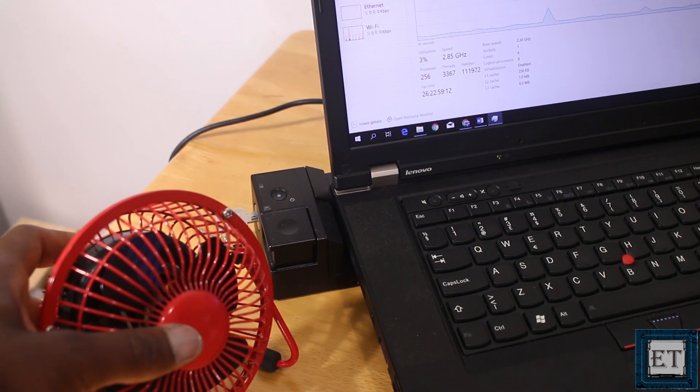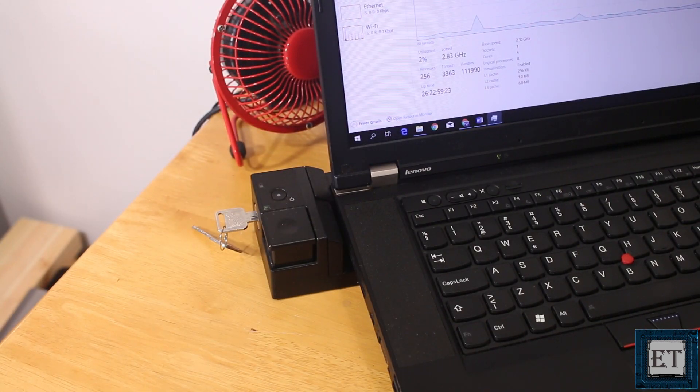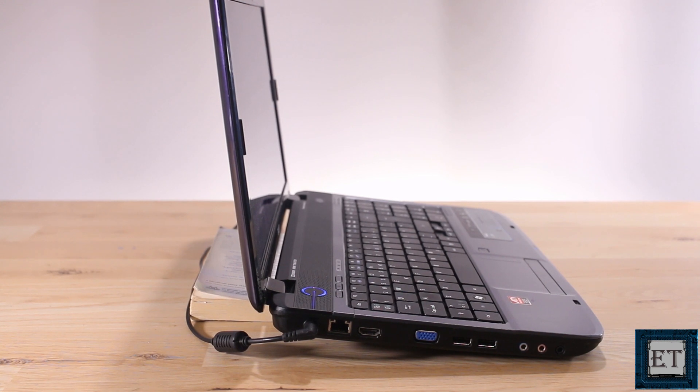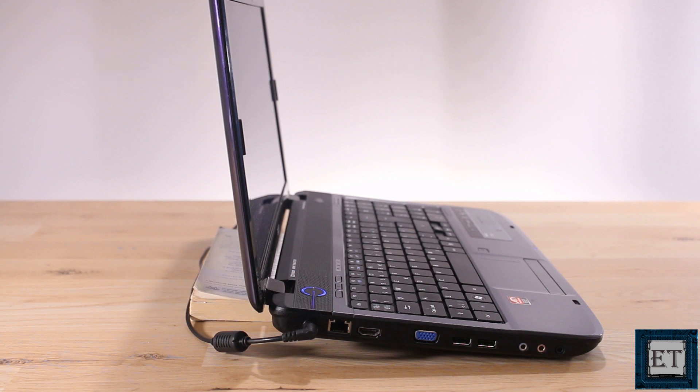You don't need a mini electric fan or a docking station to prevent overheating. Keeping your laptop on a flat, dry surface would suffice. But if you feel the need to increase airflow underneath, you could put a small book or some other object under the battery when placing it on a desk. Finally, your room temperature also matters — keeping your laptop in an air-conditioned or cool environment would allow your system to cool down and prevent it from overheating.